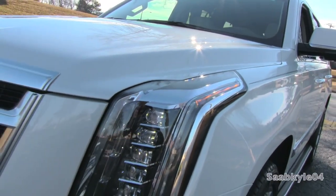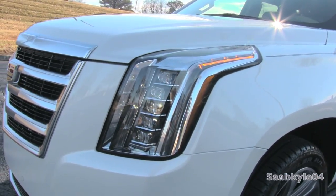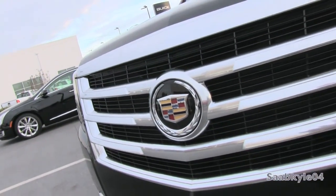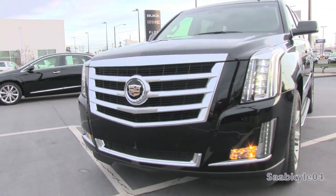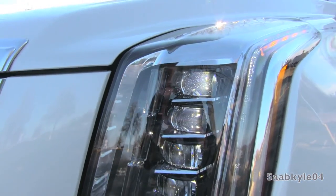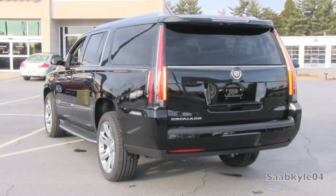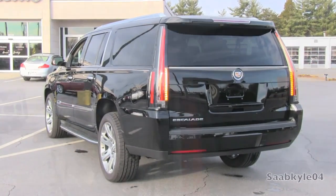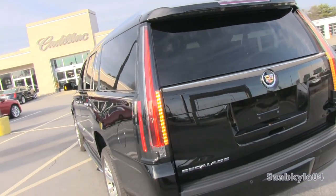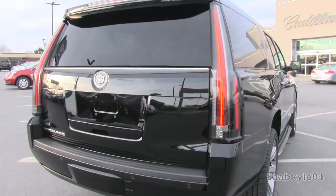The stunning lighting elements all incorporate LEDs and take inspiration from urban skyscrapers and the vertical lamps of the past. The headlamps extend back into the fenders, embossed with the Cadillac script on top, and feature the first Total Internal Reflection LED high beams consisting of four vertically stacked crystal lenses, with five crystal lenses for the low beams. The huge rear tail lamps are outlined in black trim for dramatic effect. In total, there are 142 LEDs — 17 in each headlamp, 7 for each lower fascia lamp, 29 for each tail lamp, and 36 for the high-mounted third brake light.